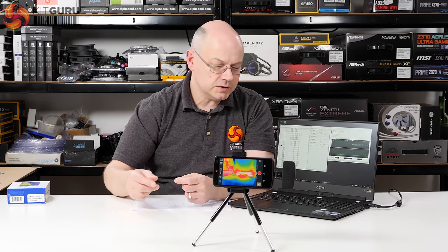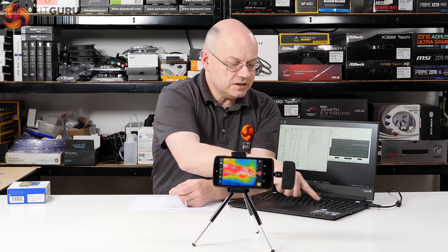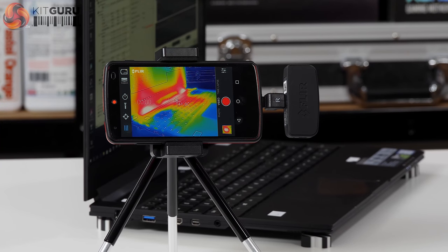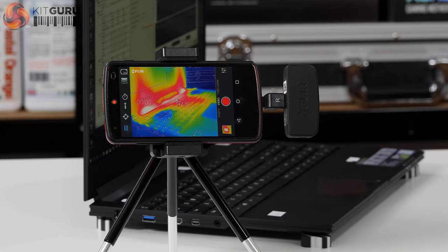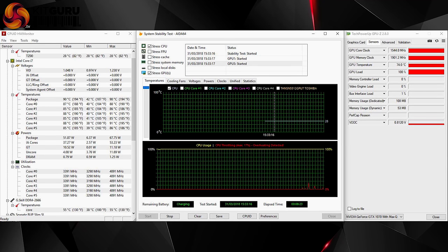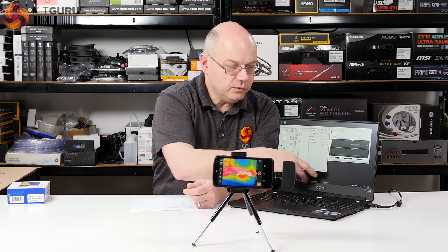When I stress the laptop you'll see various parts get hotter, exactly as you'd expect. The chips are under here, the coolers are there, so it's going to be that area that gets hot — and also the lower edge of the screen. There are valid questions about temperatures: does the keyboard get so hot that you'd lose your fingerprints touching it? The answer is no. While the chips inside are 80-something degrees — the CPU around 80, the GPU around 74 — various parts of the laptop like the keyboard area are around 48°C.